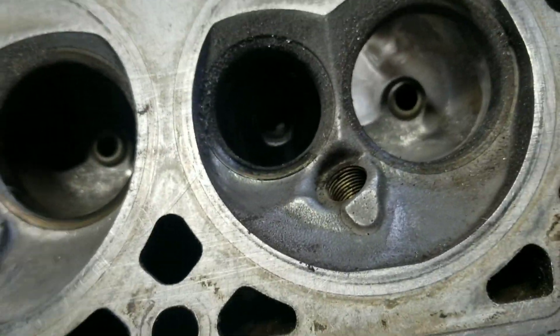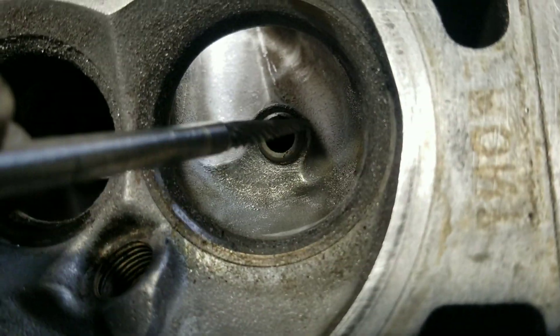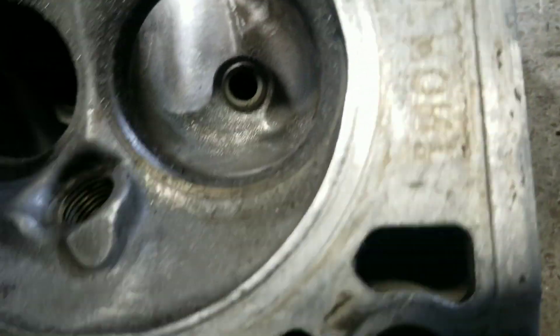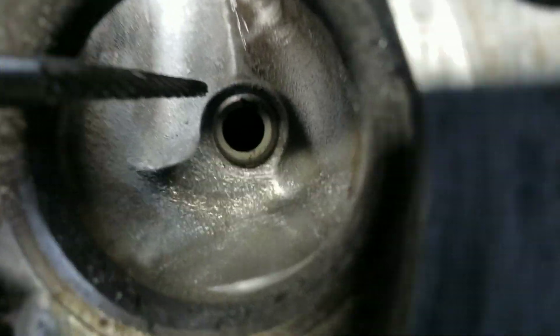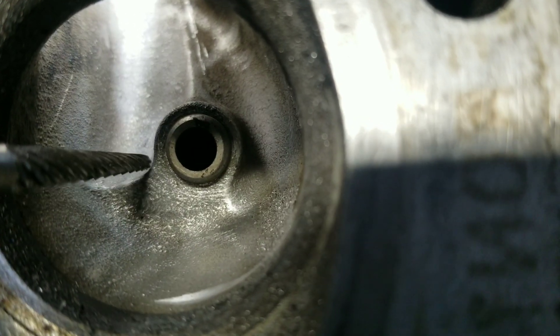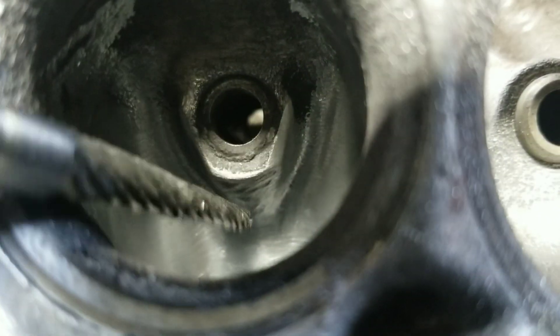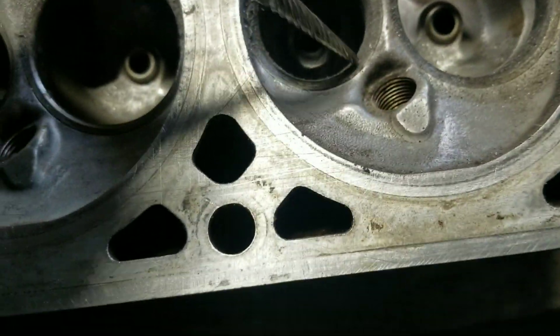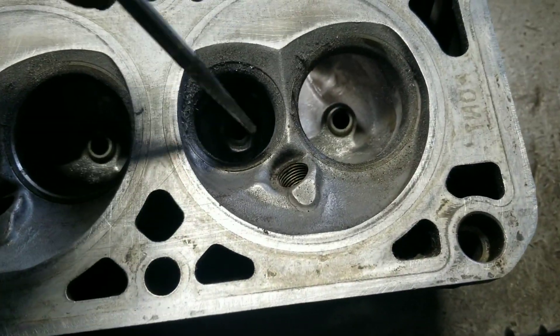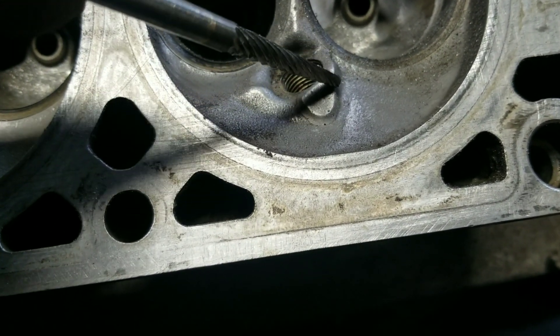The main goal on this one here — you're going to work around the valves. You see all this meat in here? We're going to get rid of that. All this meat in here, we're going to get closer to the valve guide. All this meat — like a ramp — this one is going to go down all the way. So this bump is going to disappear. Same on the other side, on the exhaust side. All this meat is going to be gone. It has to be close to the valve guide. Right here there's not much to do — just sand it down, get it smooth. And then we're going to remove a little bit from here and a little bit from here.